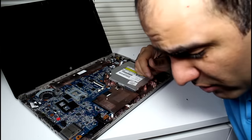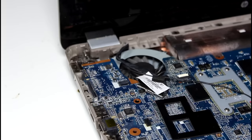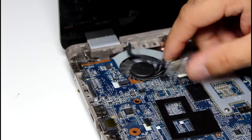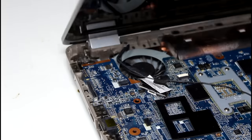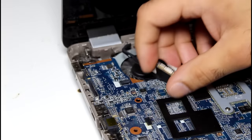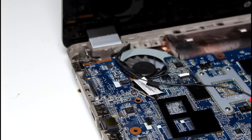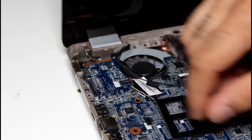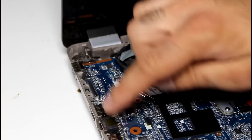On the ground. Every laptop can have a different problem. But in many cases, the monitor, camera, or microphone malfunction. And it's usually because of the signal cable that runs through the monitor hinge. It can break easily as it's constantly under stress. And trust me, I've tried. You cannot reliably fix this cable unless you never close your monitor. You better buy a new cable or computer. In some other cases, your connectors like USB could have been broken off the board, and usually you can solder them back on the board.